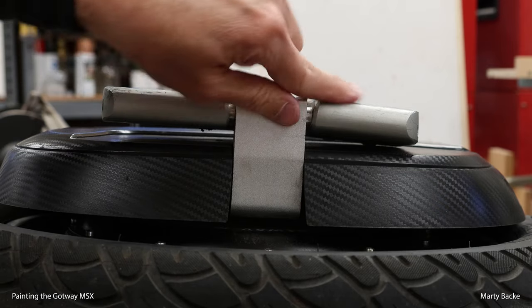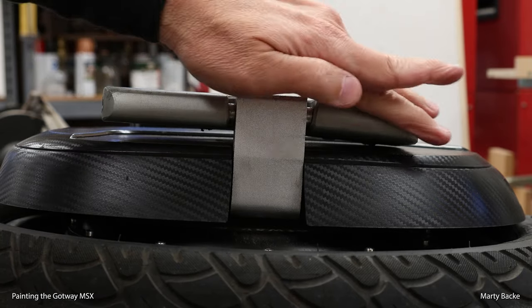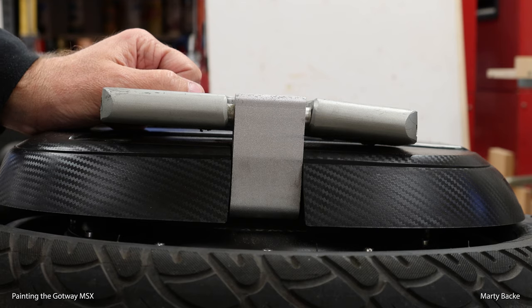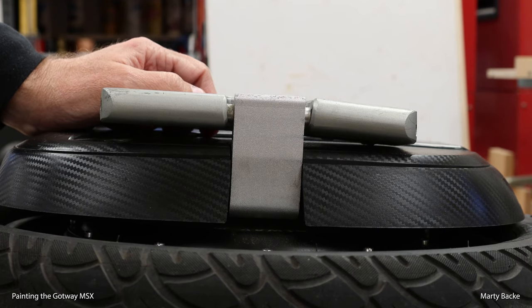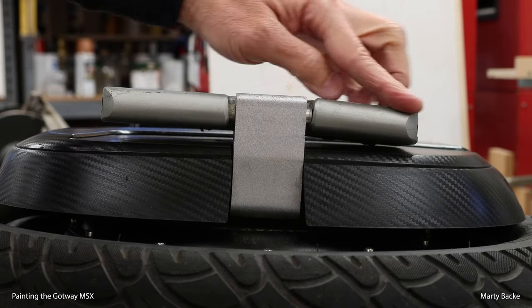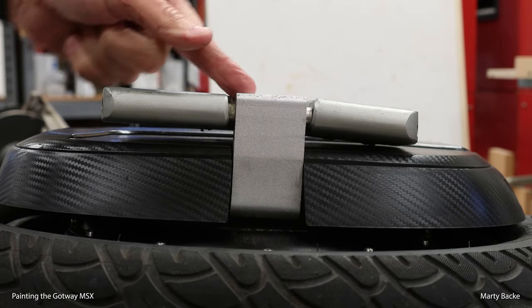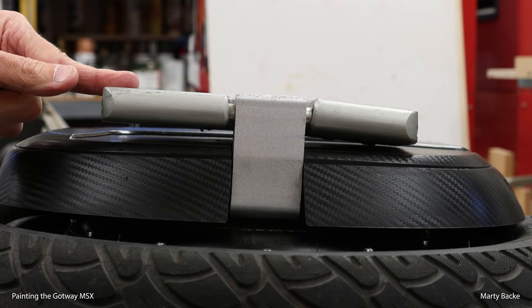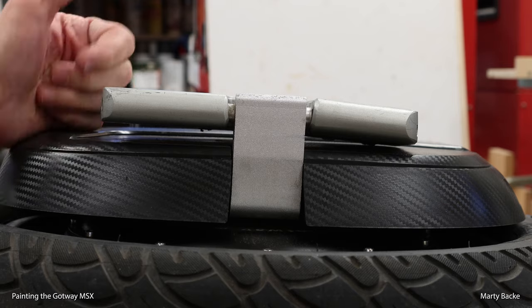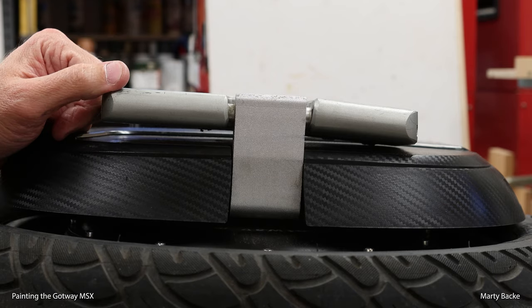You can see how bent this is. I gave it a good try hammering it and the pedal rod is not budging at all. So I'm going to try cutting this piece off and hopefully it will just slide off. If not, I'll just have to keep cutting away at it.